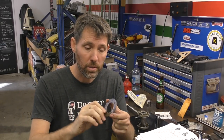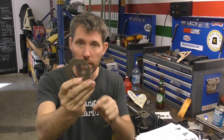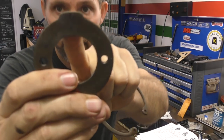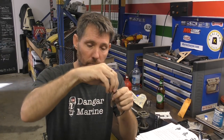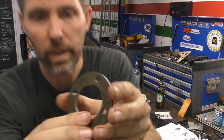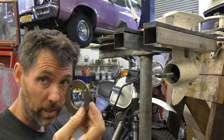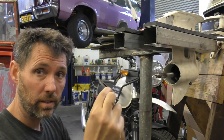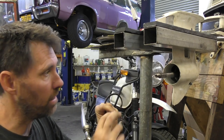When we start putting it all back together, the first thing we need to do is put the retaining plate into the gearbox. It goes in behind the reverse gear, and where we had the pivot point for the gear selector mechanism, this little tab here has to drop down. So this bit goes down, we get it along the prop shaft, drop it in, and then a circlip holds it in — then the bearing carrier threads into the holes on this plate. So retaining plate first: I'm going to slide it in at this angle so I can get the tab on the bottom in and then stand it up.